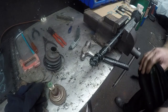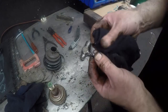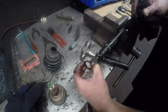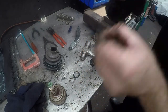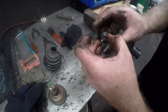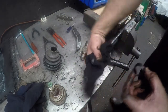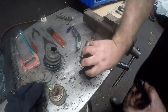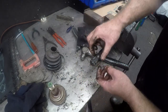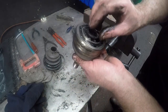You can see there are two shims inside like that, which we are basically just going to clean off. They basically fit together — you can see it is concave, and you fit the convex on the outside. So when you put it on it goes against the shaft, on the inside, and that bit basically fits inside the CV joint to centralize it.